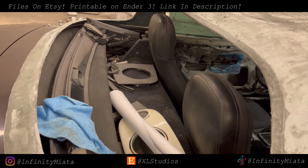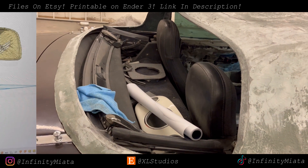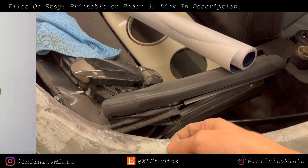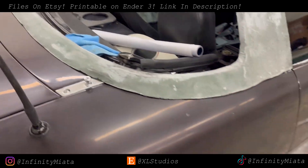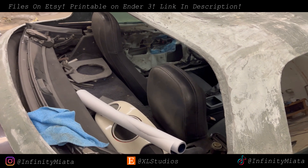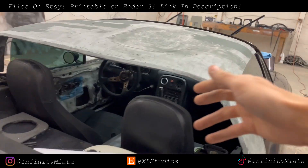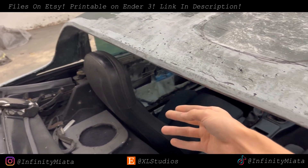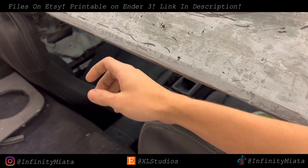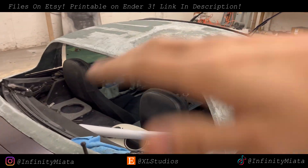The big thing right here is I'm going to be running a 3D printed louver on my back window. I'll put a video up — I CAD modeled it off of the acrylic back window and it fits to the nines. I'm printing it right now, and once I get it all printed out and done I'm actually going to try and rivet it in just to see how badly it may have sagged. I sat here and measured every single inch of this car to get it to fit as well as I could, so I'm not worried about the louver fitting. But this part right here is really crucial — you need that to be flat. If the louver ends up sitting high, I'll know it's sagged that much and I'll have to lift it and rivet it to hold its shape.